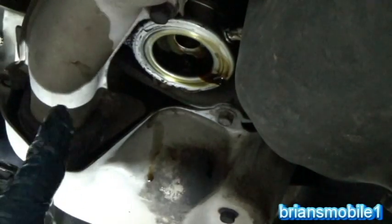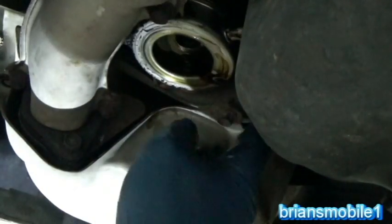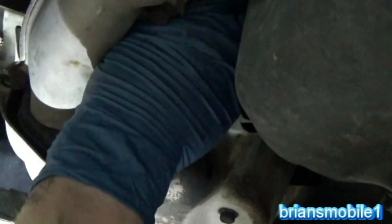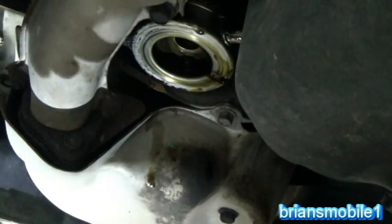At this point what we could do is wait till the oil quits dripping and start a new drip of the antifreeze that's going around and through this. Or we could just pull it down just a little bit and then sneak the o-ring out with the dental pick and then get a matching o-ring. I don't have the patience for this leak anymore. I've got a little 90-degree shepherd's crook tool, or I can work through a mirror. I can feel the groove.